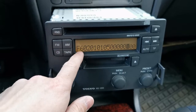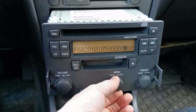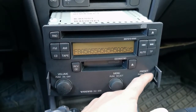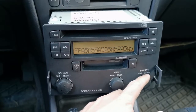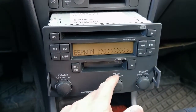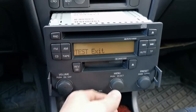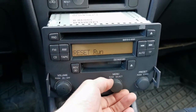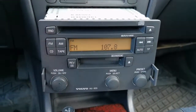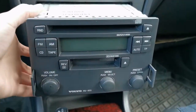Navigate to address F6. You can see it shows '3' — three attempts were done already. We want to change that. Place your cursor at address F6 over the number 3, and with the middle knob change it to 1. Then navigate to the right to find the exit. Go from EEPROM to 'test exit', press it — boom, you're out of there.